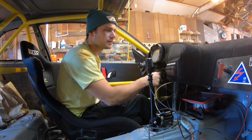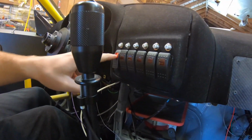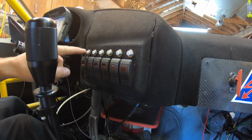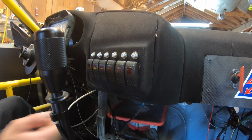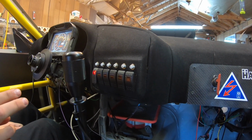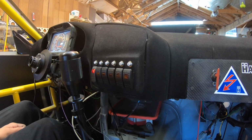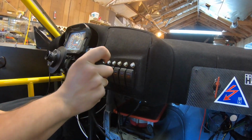So I bought the Hard Motorsport switch panel with circuit breakers. So if you see, each one has their own circuit breaker and light, knowing when it's on. If it trips the breaker, it trips that 5-amp breaker, and then you restart it. All the wires are on the back. So I'm just gonna use these as my fan. I'm gonna wire both fans, same input from switch, but the input from a switch is gonna power 2 separate relays for each fan. And then I gotta remount this.